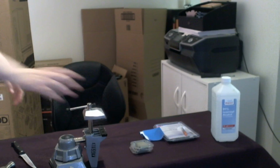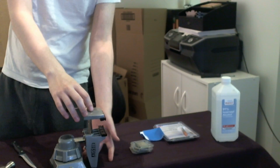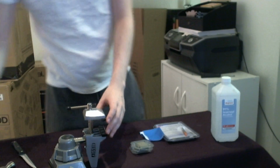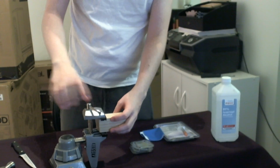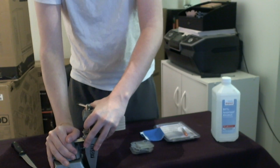I could use the vise on this table. I wouldn't be able to do it on the tablecloth. I'd have to go underneath it. But since this is glass underneath, there's a high probability that by hammering on it, I'll crack it. So typically your best bet is you have to think about the vise in terms of the work it's going to be doing, right? If you've got something held in place by a vise and you're hammering it, you need the vise to be 100% stationary.